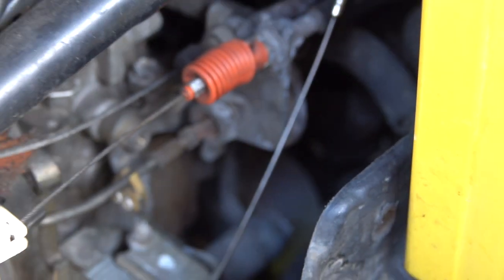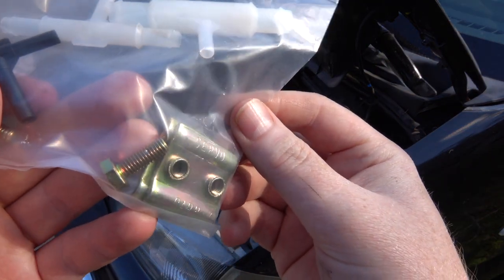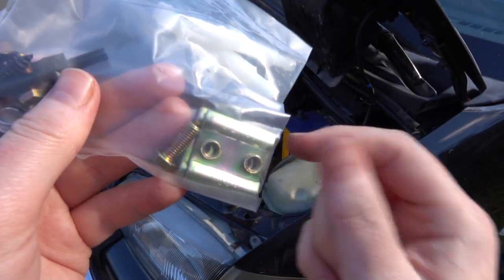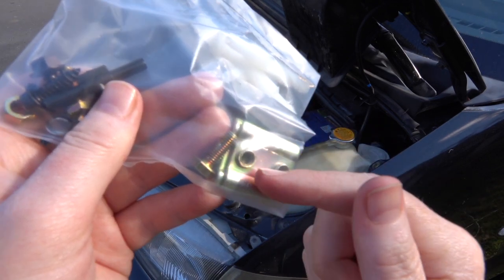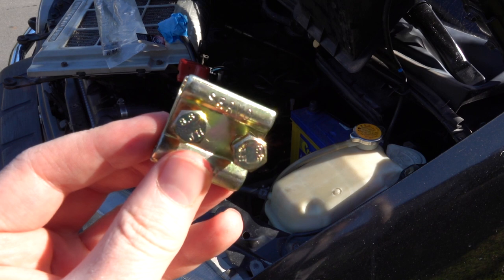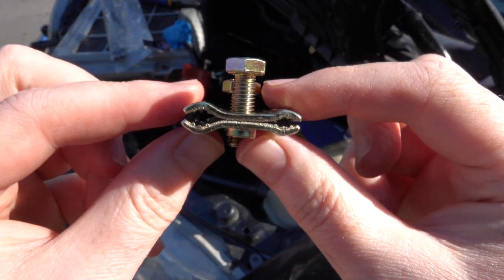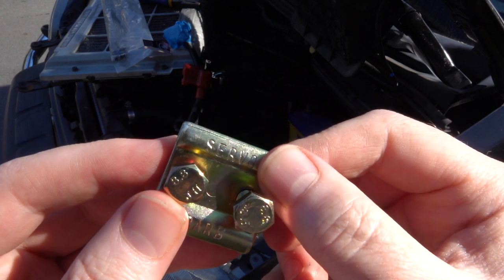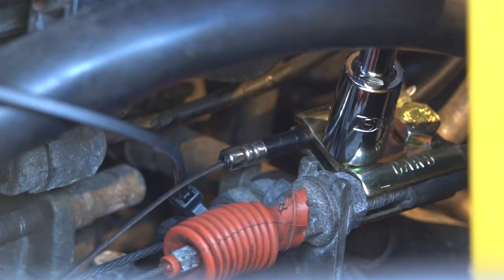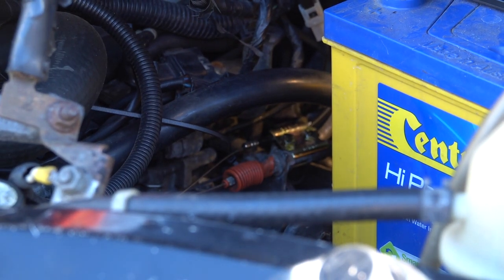The plan is to attach the steel wire to the throttle cable. To fix the actuator in place, this little plate is included. The idea is you clamp it and connect both the existing throttle cable and the actuator cable, held in place by strong bolts. Pay attention to which way around it goes because one side is labeled 'servo' and one side is labeled 'carb' — they're actually different sizes. Servo is for the small thin wire and carb is for the bigger existing cable. Make sure it's tight because if it rattles loose it could cause serious problems.